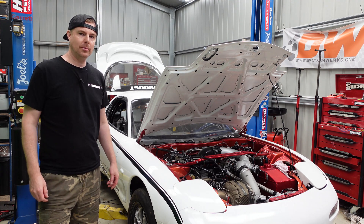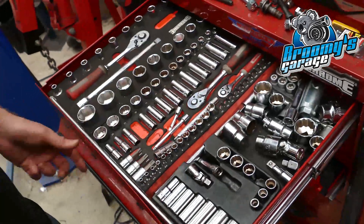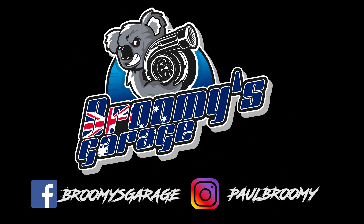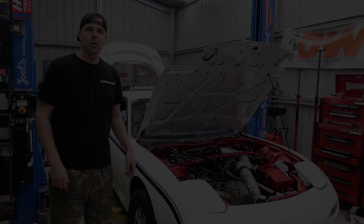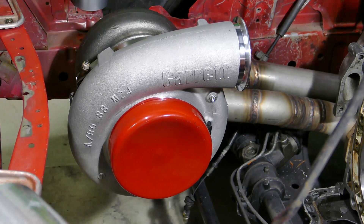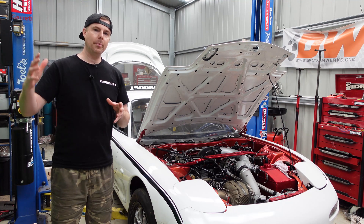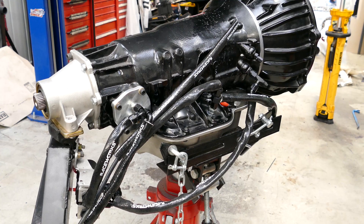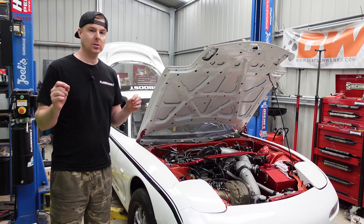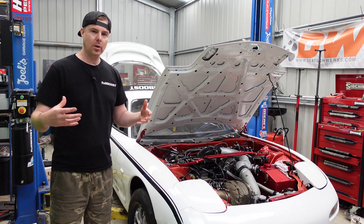What kind of difference will it make in spool times? Well, let's find out. It is, as I said, an 88mm turbo, which is really large. It does run methanol fuel, which helps it a little bit. However, the tiny little 13B rotary doesn't make torque until much higher up in the RPM range. Couple that with a turbo 400 auto and a converter that's being spec'd on the tighter side, specifically as ordered by us like that because we want to run really fast in this car.